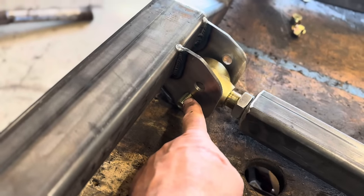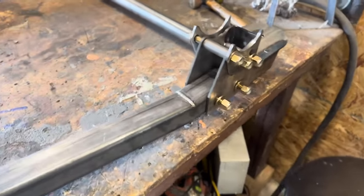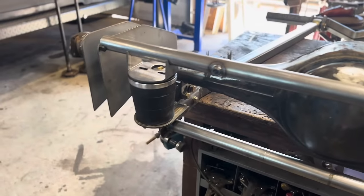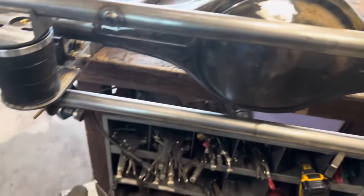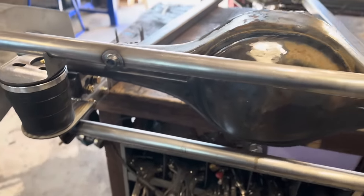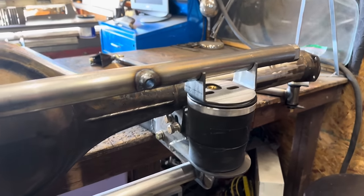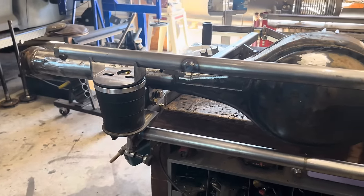You've got a couple different holes you can use so you can adjust your pinion as needed. These are heavy-duty, so if you need to mount something on top of them — maybe move your bag or add an additional one — you've got plenty of options. This is pretty much how it's going to assemble: airbags behind the axle, upper shock mount, and the lower bar for the bottom shock mount. It does not come welded in place because that's something you have to do after you set up the angle it's going to sit at in the actual vehicle. It comes with a really nice frame notch, nice and clean. Now you're going to be tempted to tack stuff in place on your workbench — don't do that. Get it in the car, get everything set up, tack it, then probably pull it all out, finish welding, and put it back in for final welding.